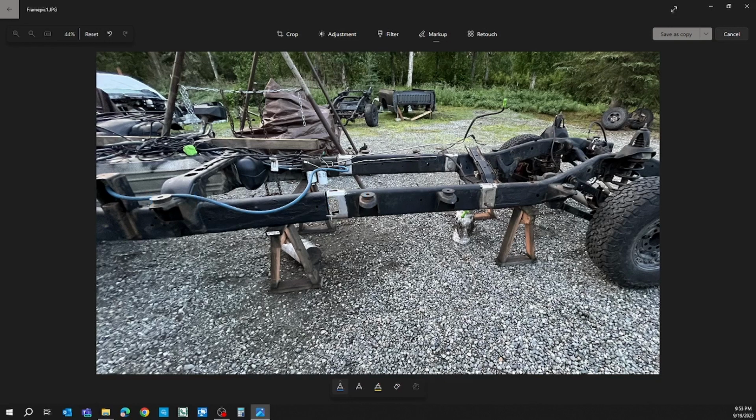Definitely more than you really need, but like I had mentioned before, I cut it about 2 inches back on every corner, and bent the front end in and tapered it in, welded it back up, just to help it slide in a little bit easier. And this section here, your expanded section of the frame that this slides into at that factory splice, is about 4 inches. So with a tapered front end, the additional 2 inches in here, I had no problem getting my measurements there to there.